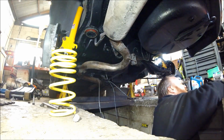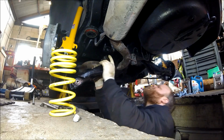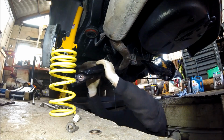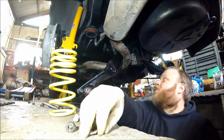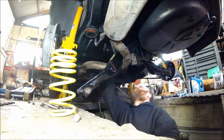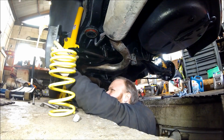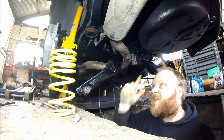So let's get the lower arm in first. Put the lower arm in. Basically push that up in there. That's it. Pin. That's it. Right, there we go. Washer on, like so. Then just wind the nut on a couple of turns, like so. And we check it onto the axle. Make sure we've got clearance, so we'll go in. Which it does, so that's good. So that's on there. Right, next. You get the pin out of the boot, Chase.